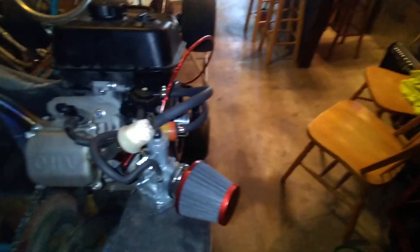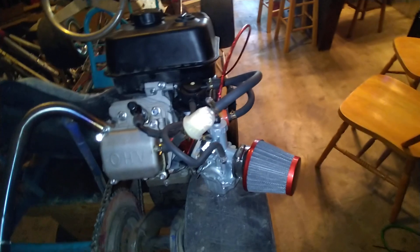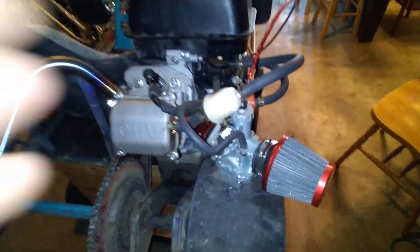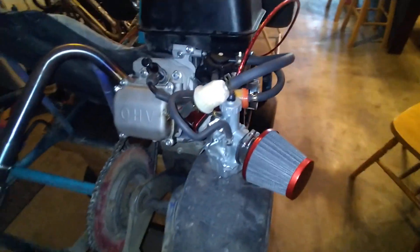These things come in the mail and you're going to have to adjust them. The best bet — and you can do this before you even hook it up — just get it to snug position, dial it back a turn and a half, it's set. Then all you have to do is adjust your idling screw and you're good to go.